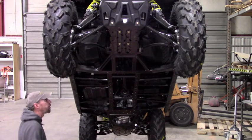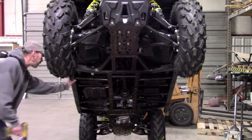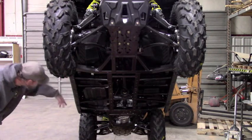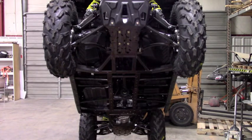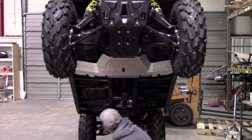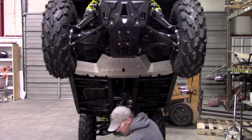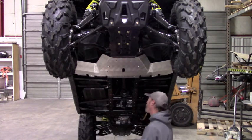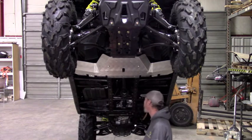Now we're ready to actually start installing some skid plates. You'll do that to both sides — it's already done on the other side. So it's the first hole and the third hole, opened up with about a half-inch drill bit. There are a couple spots on this plate where you need to hang the clamps before you install the plate.